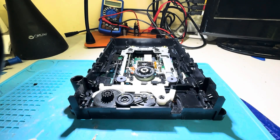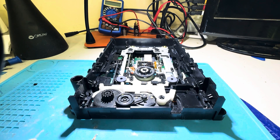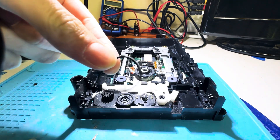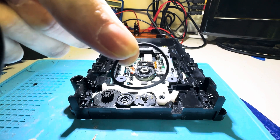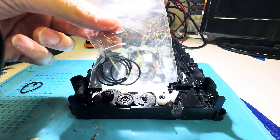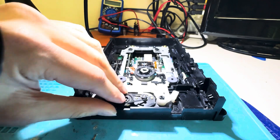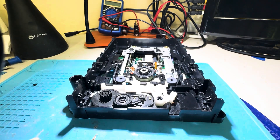You've probably heard many times that as time goes by, the elasticity of the drive belt becomes less and less responsive, which can lead to the disk drive getting stuck and not properly ejecting your disk. That's this little thing right here. Oftentimes you can tell because it may actually be worn when you remove it and just hang on by a thread. Luckily, replacements are pennies — I got a pack of 25 for, I believe, $5. Super easy to get, super easy to reinstall, and you're back on your way.